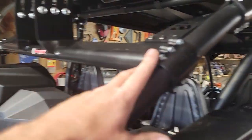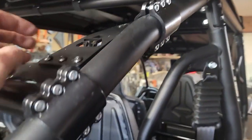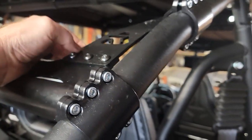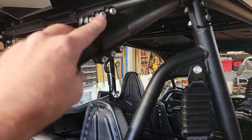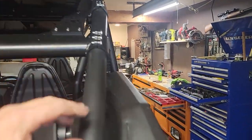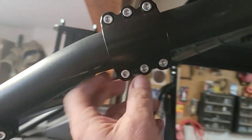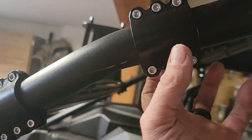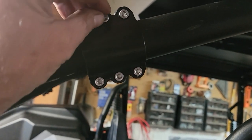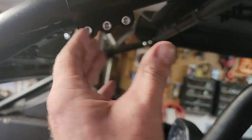These pieces here are not a problem, but the brace — you add these braces on, they come in the package. It's the same Allen head as these here, only it's got a 13 millimeter bolt on the back. Loctite on those nuts and bolts. These here wouldn't fit, so I took a pair of big channel locks and bent it down just a little bit to get the angle right. I didn't want to heat it up. My son helps hold it, but these don't go in — you can start a couple of the top ones, but it ends up being cockeyed and the holes don't line up. The gap is too far, and when you grab it with your channel locks it twists and then they don't line up.